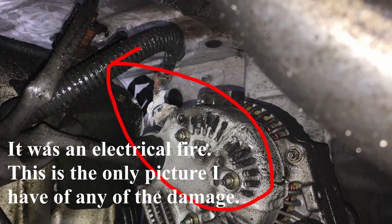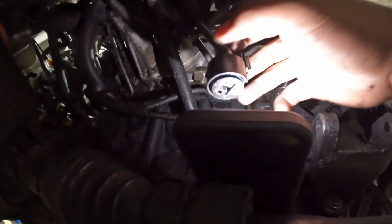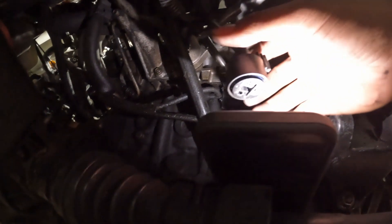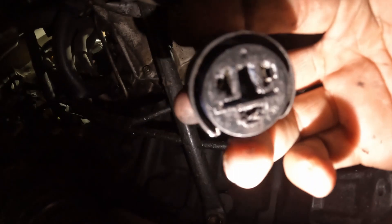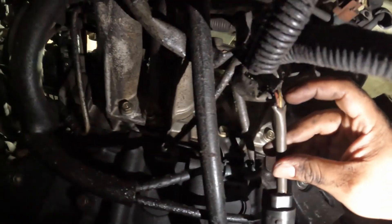I had to conclude it's probably an electrical issue. For those who don't know, some years ago — before I started doing YouTube — this car actually caught fire. After the fire I made repairs myself, but I had to splice into quite a bit of the wiring. A lot of stuff in that area got messed up. I assumed that my previous repair work was failing and causing this, but after poking around I found it was actually older wiring. The plug for the alternator has corroded prongs, and coming up a bit higher the loom has broken and the wiring inside is torn open. There are multiple areas of the harness that need repair.